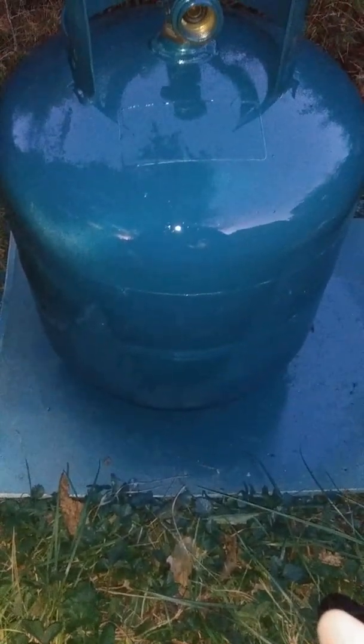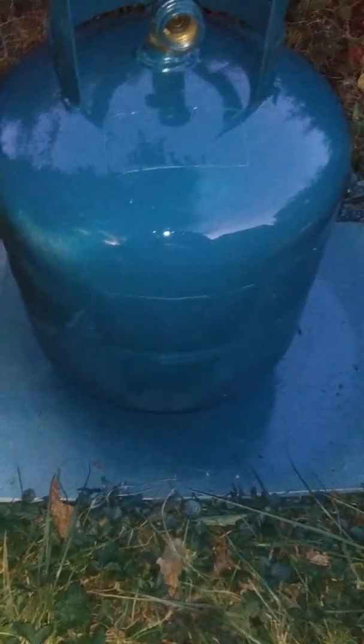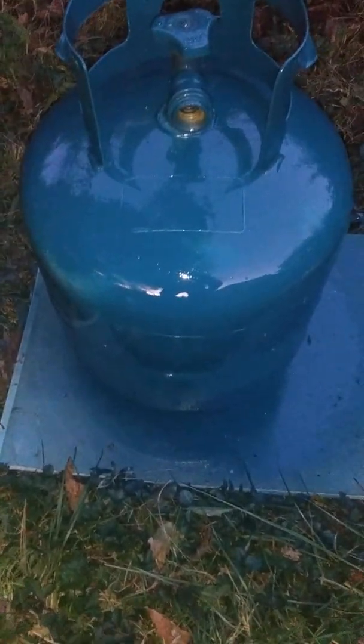So I guess that's the other thing too, is you want to keep a consistent spray, consistency on your pressure on the sprayer. You want to keep it in small areas with light coats. And just go from top to bottom or bottom to top. Do not spray in a circle. Don't think, oh, because it's circular, you have to spray in a circle. You don't. You will spray in a circle by doing section by section. So those are my tips for spray painting.